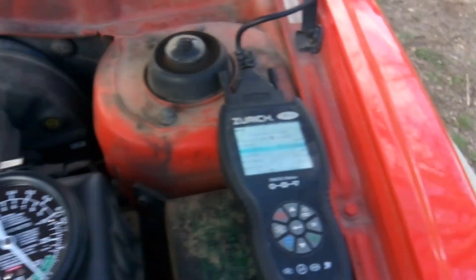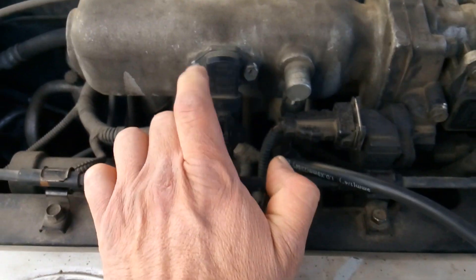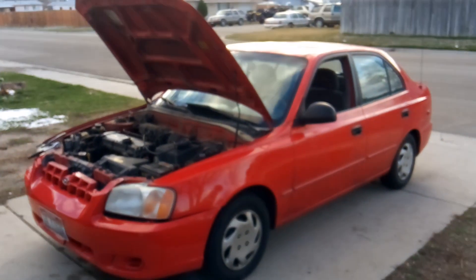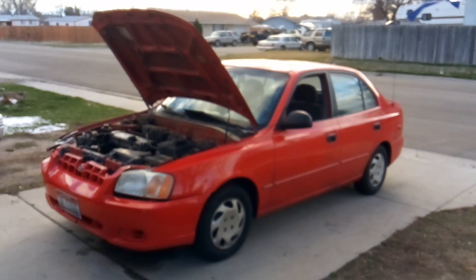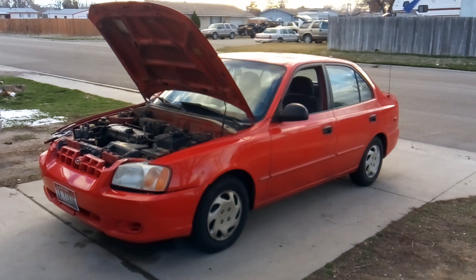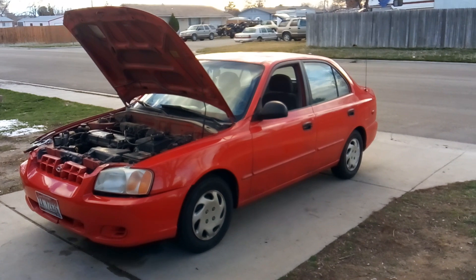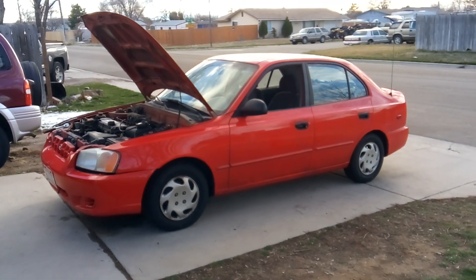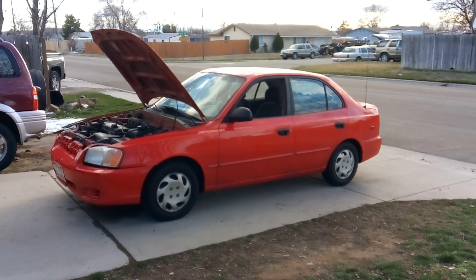Electronically it's not good. The best way to fix this issue is to replace the sensor, or possibly clean it out and see what happens. There you go folks — that's a good example of why you can't always trust your check engine light and computers, and why it makes sense to do both mechanical and computer diagnostics as well as visual inspections. The fix for this car is going to be a new MAP sensor. This is Matthew your friendly neighborhood technician — thanks for supporting me, please like, subscribe, and share the knowledge. Signing off.